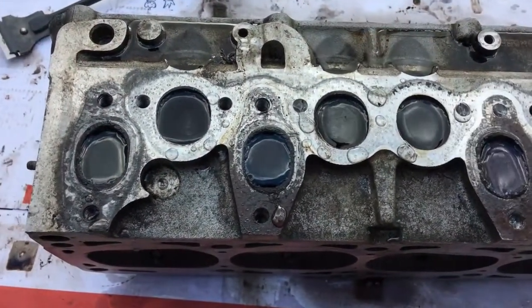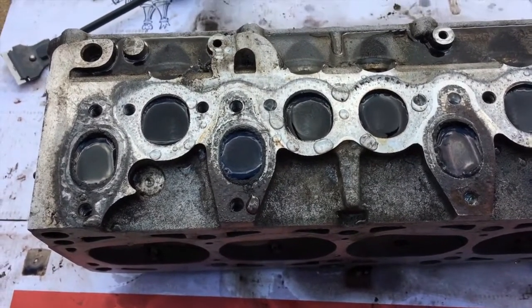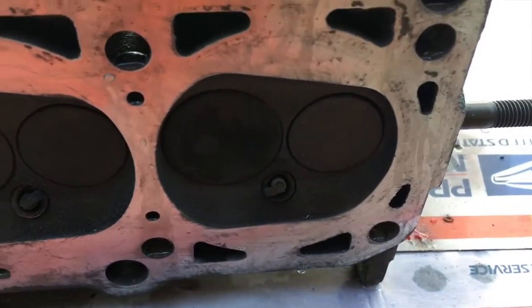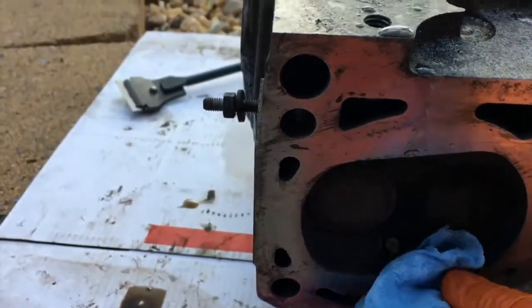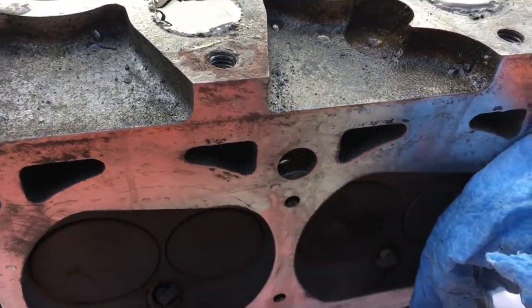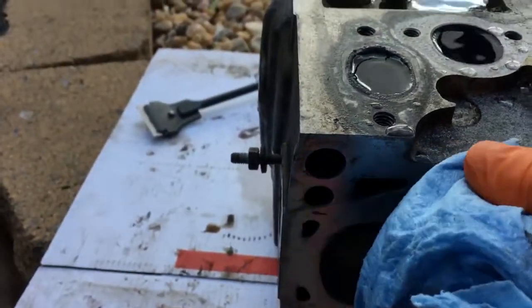And this is where your fuel injectors went, right? So I didn't want water getting into my fuel injectors because the orifices are so small, I don't want any rust getting into them. So I pulled my fuel injectors. And no obvious outward signs right now of leakage, but it's only been about a minute and a half. So to test the seal, I'm just getting all the spillage off of here so that I can throw the camera here on time lapse and we'll watch to see if anything forms where it shouldn't.